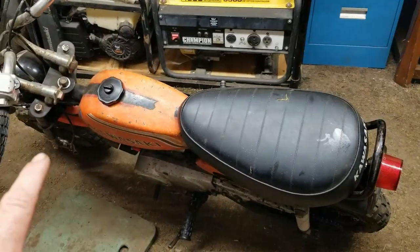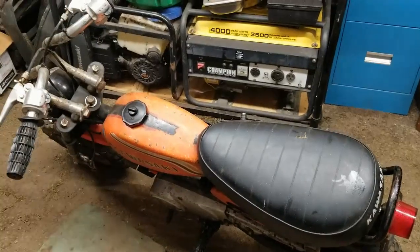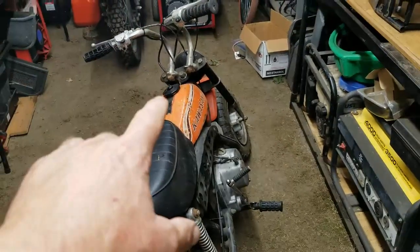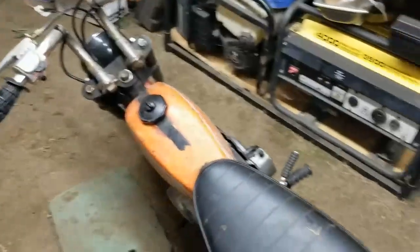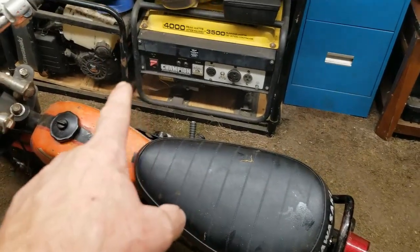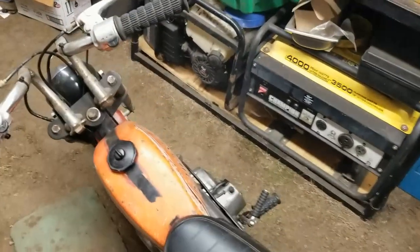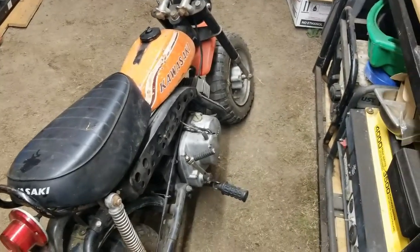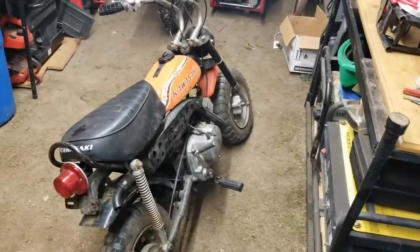All that stuff is wired correctly and this is pretty much it, guys. I figured I'd do a short video to show you — this is raw, this is a get-on-and-go-have-some-fun situation. Right now I have a tank of two-stroke pre-mix in the tank, and two-stroke oil in there too. The oil pump was bad on this bike, so the previous owner pre-mixed it in the tank and never hooked up the oiler. I hooked up the oiler and got that all done, so now I need to drain out the tank.